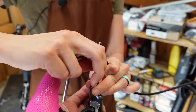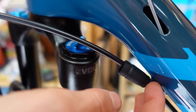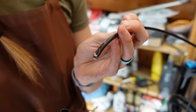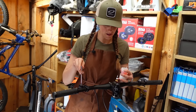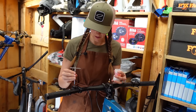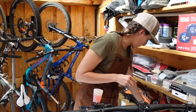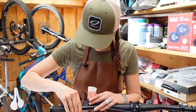There she goes — perfect. So go through the checklist: barb is in there, we have the rubber thing on. If this were not attached, we would put that on, then put the olive on, and our barb is in there. I'm going to tighten her down. The last thing we're going to do is do a lever bleed on both of these. Pretty much always have to top up your fluid when you cut it, no matter how careful you are. We have a whole video about how to do lever bleeds — it's a very good skill to learn, even if you don't want to do full brake bleeds. We'll put a link to that right up there.